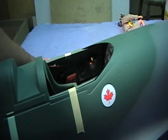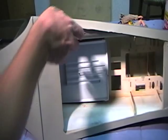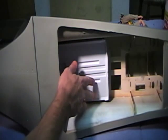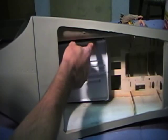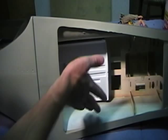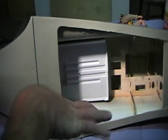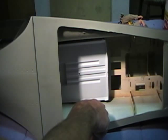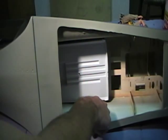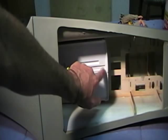If you're going to put a 50cc motor in there, you're going to have a lot of vibration. Even though you're putting the stringers across, I would go ahead — after it's all installed — and take another piece and glue it to the top of that stringer to actually touch the fuselage sides. That'll support the cockpit and won't let the vibration of your 50cc motor fatigue the sides of the cockpit over time. You can glue it using Goop — G-O-O-P — available at any Home Depot, Lowe's, or hardware store. But do not use any Goop on the ABS at all; it will eat it.